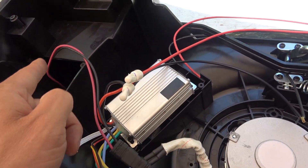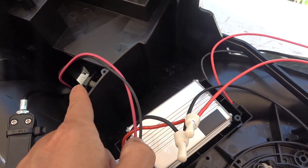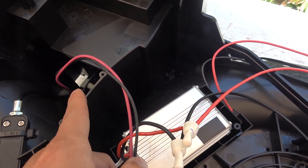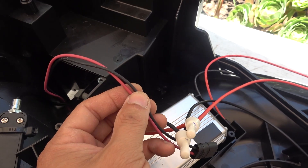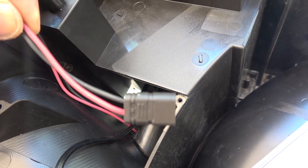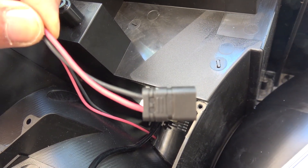This wire is the main power cable that goes to the drive motor, and I can tell it's a brushed DC motor because this is the only wire going into the motor — a brushed DC motor only needs two wires to power it.